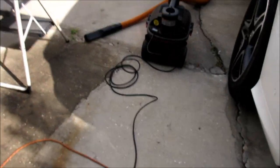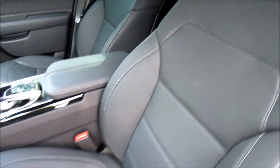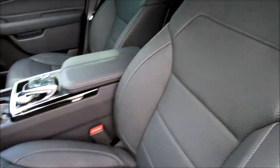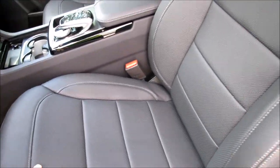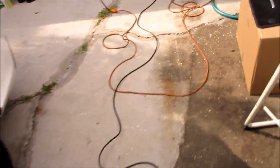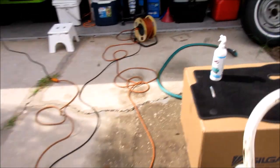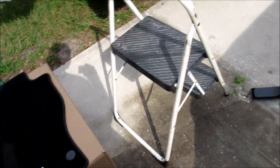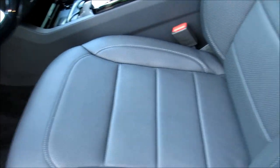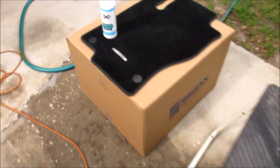Now we're on to the interior — I've got the whole thing vacuumed out and wiped down. I've done all of the interior: the upholstery, the leather, the door panels — everything has Aqua Blocker on the surface except for the carpets. Here's the driver's floor mat. I usually recommend doing the interior carpet first, then the floor mats, and leaving the floor mats out while you detail the exterior. I've got a little extra time since I'm keeping this overnight to get it all cured up and ready to go.